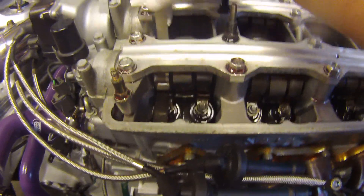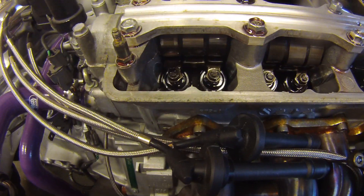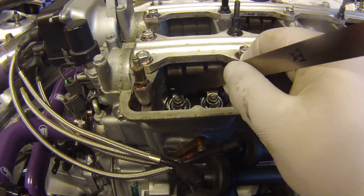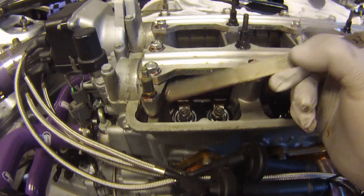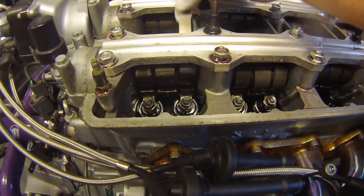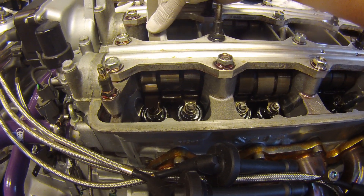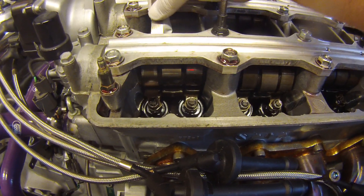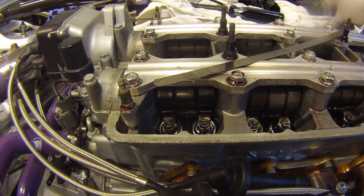This next side is a little different — it's too tight. You can see the difference: where the gap is, it's actually trying to push the feeler gauge sideways because there's a thin coat of lubricant — in this case Royal Purple HPS. On a correctly adjusted one it glides through and you can hear a noise; on this one it instantly tries to shoot it to the side and has too much drag.